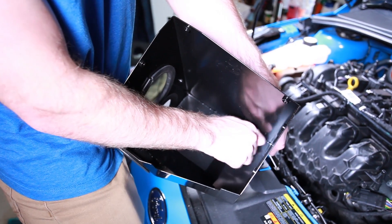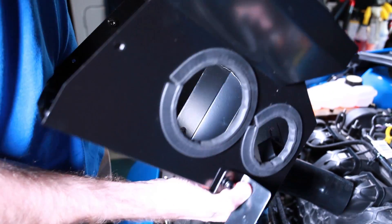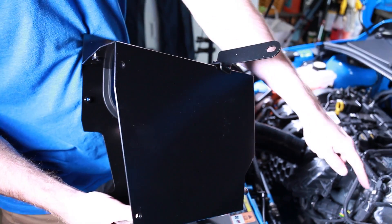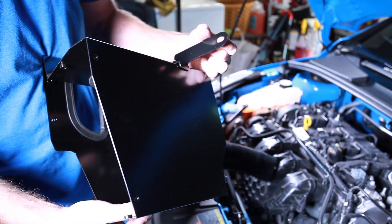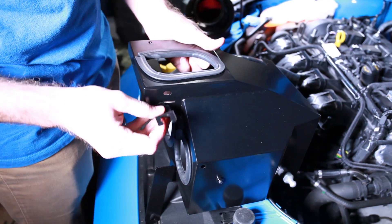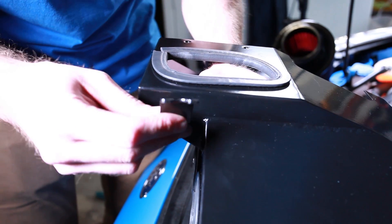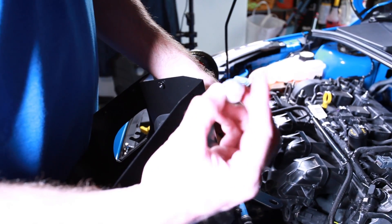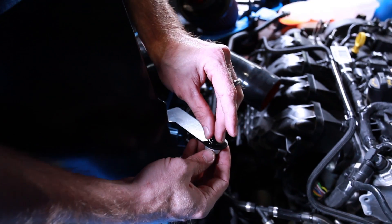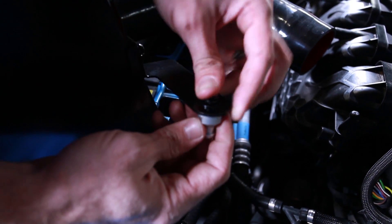You're also going to install this bracket — you can kind of see the angle it's at when it's in the car. This little spot basically goes into that nub, so you'll put one of those aluminum nubs right there, right underneath the air intake inlet spot. That's just going to flap up like that. We'll put a nut, bolt, and washer on that portion, then put this last aluminum nub on the end. Got the lock washer, regular washer, and bolt down there, so just temporarily tighten that up.